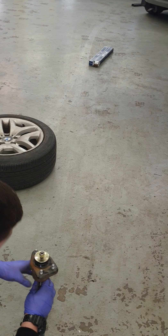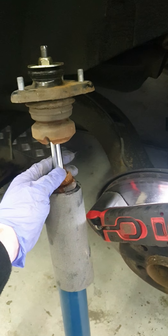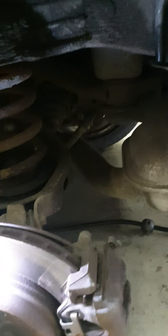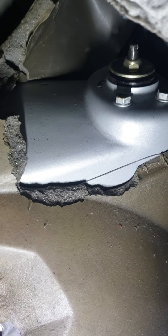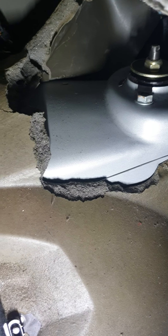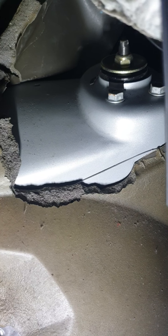Do everything in reverse order — just tighten it all back up. The new strut mount is on, and you can see we now have our three mounting bolts. We need to line those three mounting bolts up through the top. You may need someone to help hold it up while someone else starts the nuts. I had to get someone to come in and give me a hand. I'll tighten the 13mm nuts, then go back underneath to mount the bottom bolt, and then the shock is done.